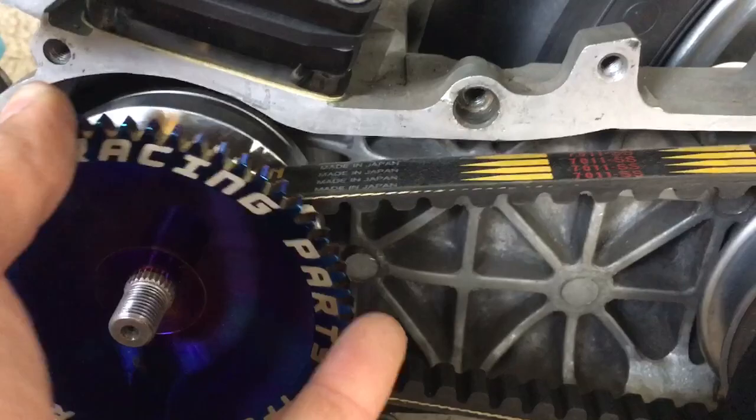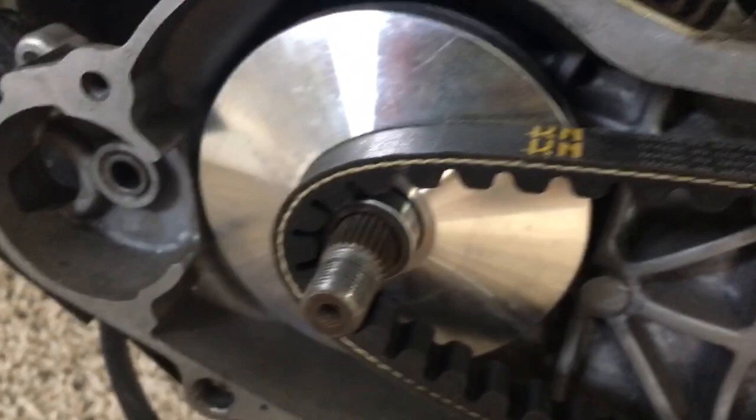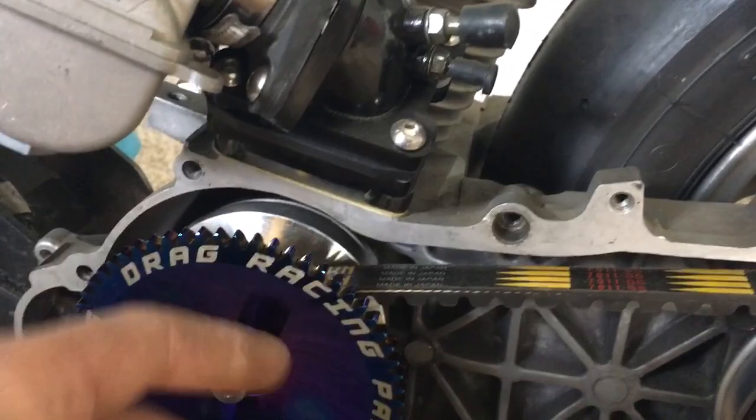On this is how I would run this bike — looking at it a little bit closer, I'd probably put one shim in it. Because what I like to do is I like to have just a tiny bit of slip. Because the second this fires up, the rollers come out and they grip the belt a little bit. If your boss is too long, you've got too many shims, your belt is just going to slip and eventually wear down. Because this is just going to spin until you get to a certain RPM where the pulley opens up and grips on the belt.